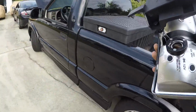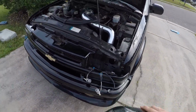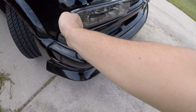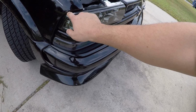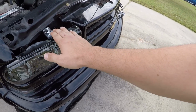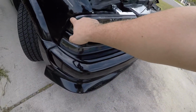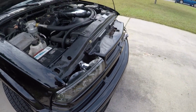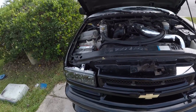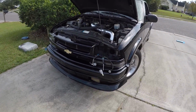Take this headlight. When you adjust that screw right there, it will pivot this piece. It will make it go in or out, and you can use that to adjust the body gap here. Your next screw that's here will lower or raise the headlight assembly itself. You can see we have pretty good body lines right here, and I'll show you both of them in a bit when they're both fully installed. But I just wanted to clear that up, so let's go ahead and get this installed.